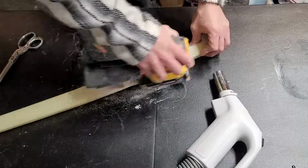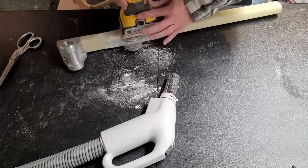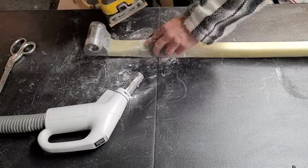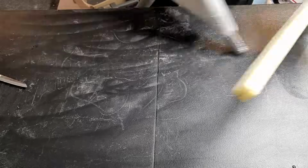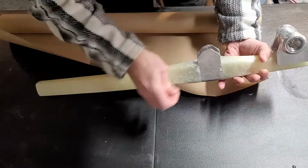The metal is still exposed. There's a little bit of squeeze out on there, but I do want to put one more layer of BID on here that is going to cover both the strut and the sides of the metal, just to give a nice, consistent, even surface so that it'll look good, and there won't be any strange ridges.